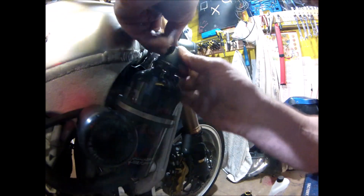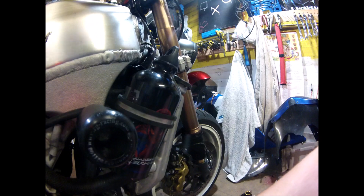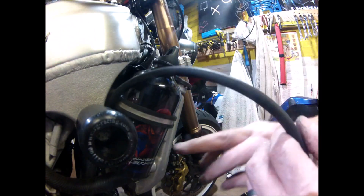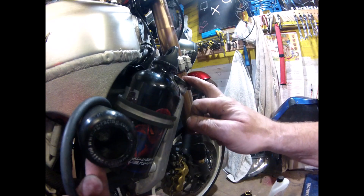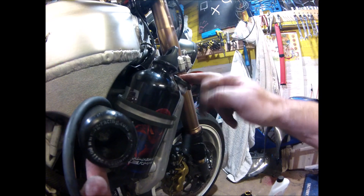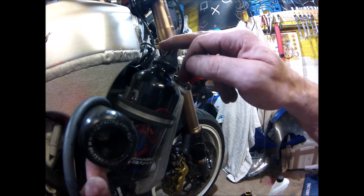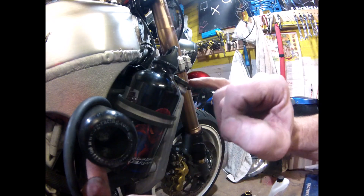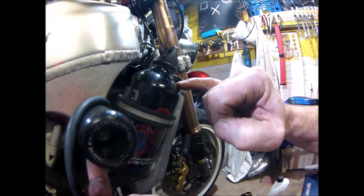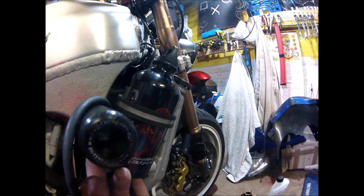It's not just for overflow purposes, the other pipe. The hot water from the radiator will push — when it's too hot it'll open the cap and push water through into this bottle. The air that's in this bottle needs to go somewhere. That's what I say about that eBay one: it was sealed, so the air had nowhere to go. The bottle itself was very tough aluminium, so it would be your pipe that went, or the pressure wouldn't release and something else on your system would go.